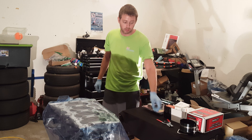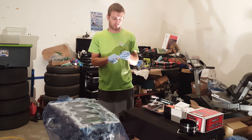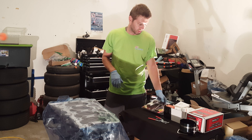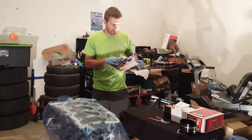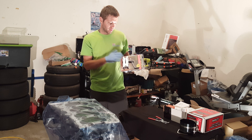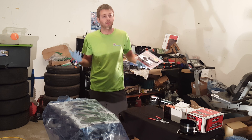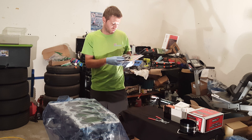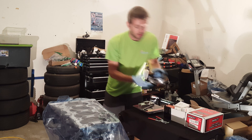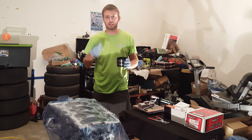You're going to need a couple tools to help you out along the way. This would be a piston ring pliers. They're real cheap — you can get them off eBay for like four bucks. This is a piston ring filer. It just files the end gap on your piston rings. Sixty bucks is pretty much as cheap as I found it. You'll use it one time and that's it, and it's just going to sit in your toolbox, but you need it to do it right. And then you also need a ring compressor so that you can get the piston into the block.